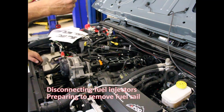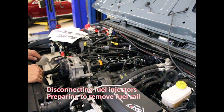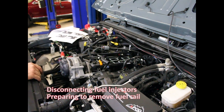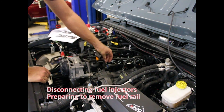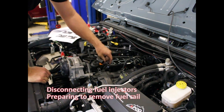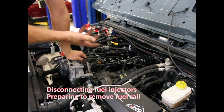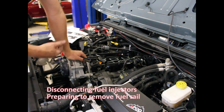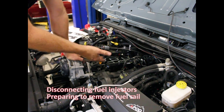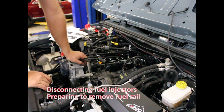Dan, will you do me a favor and loosen the fuel cap? If there's any vapors in the fuel tank and it's pressurized, loosening the fuel cap will let the pressure off. It's not going to release all the pressure in the line because that's after the regulator, but it'll help — as it sits open, it'll continue to leak if you don't release the fuel cap.